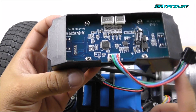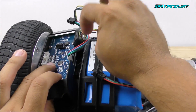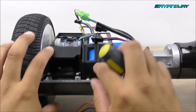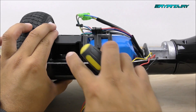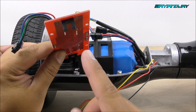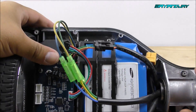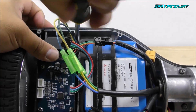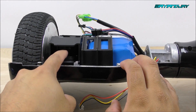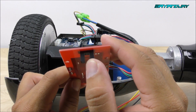Now we have everything assembled on the plastic bracket and we are all set to place it back in. Make sure everything is flushed just the way you took it out and nothing is dented or in the way. Now, make sure you press on the buttons — press on them until you see that little plastic sticking out between the two on the board. Make sure that piece of plastic is in the middle and not on the outer side, otherwise it's going to malfunction.